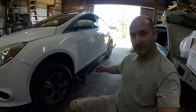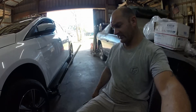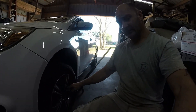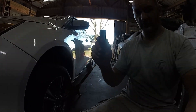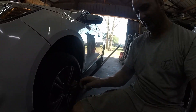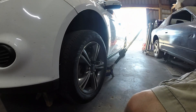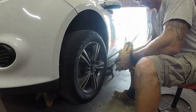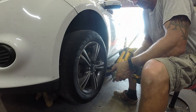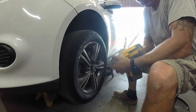First step is you're going to jack up your car. Second is you're going to put a jack stand under it for safety — you don't want the car falling on you. These lug nuts are three-quarter, so get a three-quarter socket. I'm using Olsa Tools impacts — check them out via the link in the description. We're going to use the impact to knock these off. Otherwise, loosen them while it's still on the ground before you put it in the air.